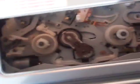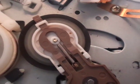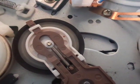Here's the inside. I'll show you the bottom some other day, maybe in another video. Here's the top upper side. This is a basic mechanism of the mid-80s. Instead of gears, they used idler tires. This idler tire seems to be in good shape — I don't see any problems with it. Here's the tape stabilizer; they used to have that in these kinds of VCRs, but not anymore.